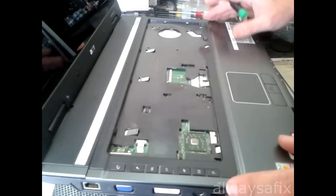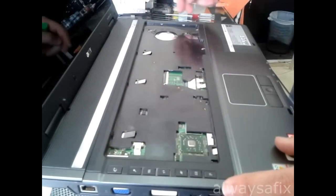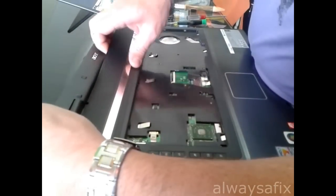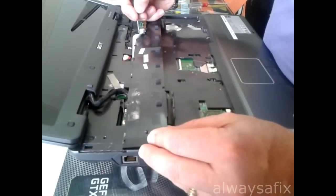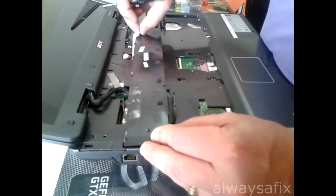Now that your keyboard's out, you have to remove the top cover. It must come out this way — there are clips or tabs underneath here, but it must be released like this. There's a ribbon cable which goes to the power switch here, so you're going to need to just disconnect that. Push the tab backwards and pull out the cable.